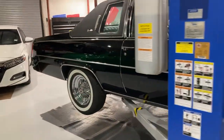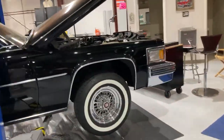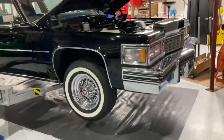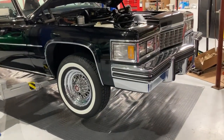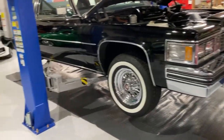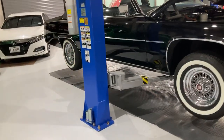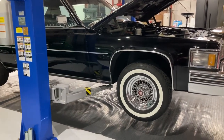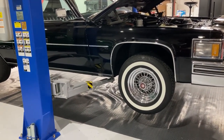What this does is it still retains a lot of the original Cadillac ride quality, but when you turn a corner it doesn't lay over on itself and wallow all over the place. It's a much more modern ride — it'll bring it up more, kind of like a '94 to '96 will ride pretty good. It helps the car a lot. Another thing added to this car are Bilstein shocks — gas Bilstein shocks.